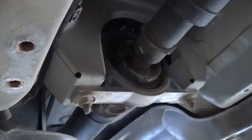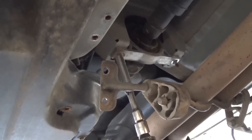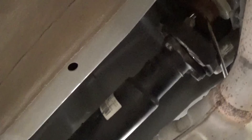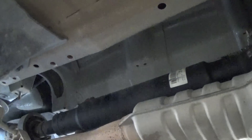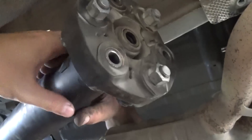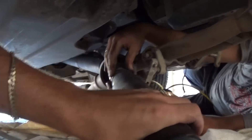We also need to remove the two bolts on the center support right here — one nut actually with a 13 millimeter socket. We removed the second nut and now we should be able to pull it out of there. With a big screwdriver, just pry it until it gets out of the shaft right there, and you can pull it to the side. Just make sure it doesn't drop on your head. Safety first guys — avoid injuries. It's fun to work on your vehicle but always be safe. Pull the exhaust to the driver's side, and right here is the flex and the drive shaft — we won't even need to remove it from the back. We can just do the whole procedure right here.